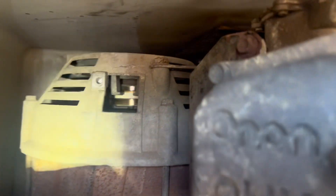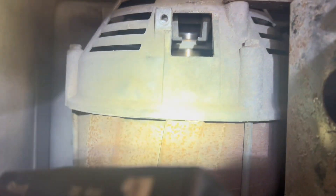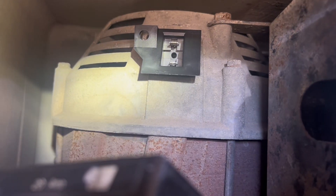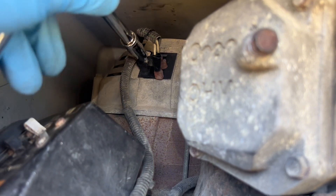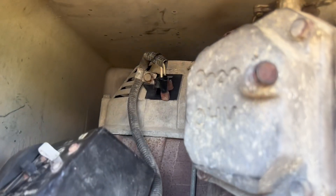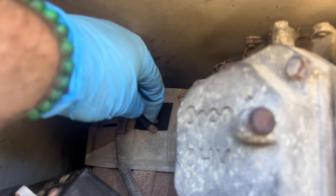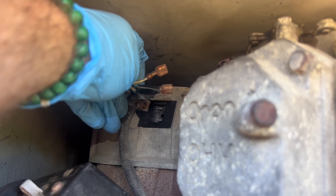Here's the new brush block — quite a difference from the old one. I cleaned the rings up the best I could. It gets installed there. It's just one 10mm bolt holding it on. There are two wires that look very similar, so when I took them off I put black electrical tape on the bottom wire to remind myself which is which.